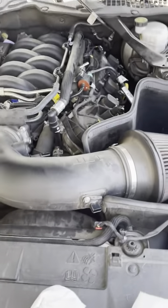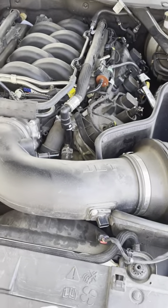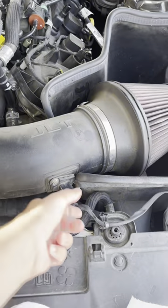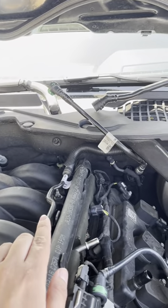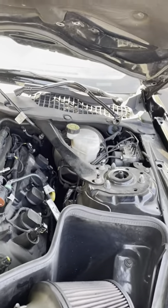This is a video on how to remove an intake manifold on the 2018-up Mustang GT. I'm taking this off because I'm going Holley - swapping out the stock one since I'm selling this tomorrow. I'll be showing you how to take off the intake. I've already done the fuel line disconnect - there's a green tab you pull back and push down to disconnect from the fuel line. Make sure you disconnect your fuel pump first.